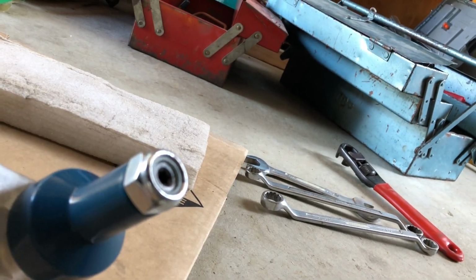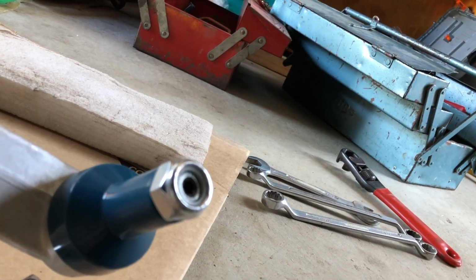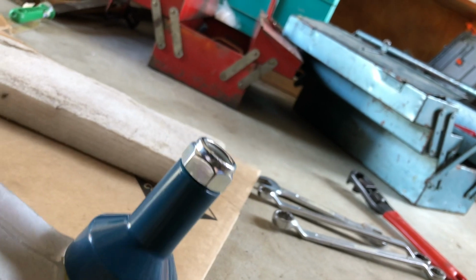You should do it before now, but obviously you want to get your new part and hold it up onto your old part and make sure that you've got the right part, which in this case I have. That's a perfect match. And you can see here what I was talking about with the T40, a little bit in the end of the bolt there so that you can hold it and you can undo the nut. It's because it's a ball joint.